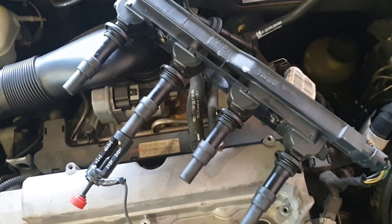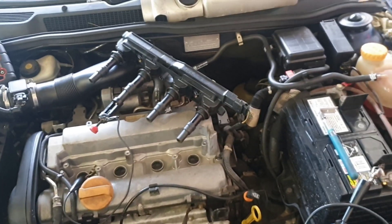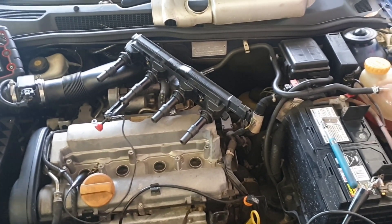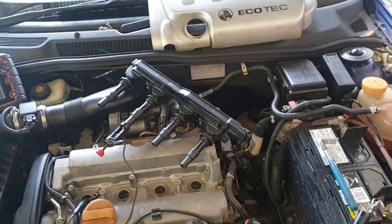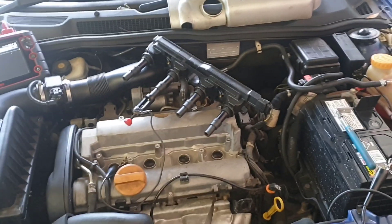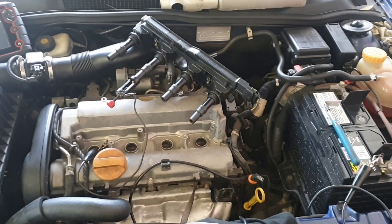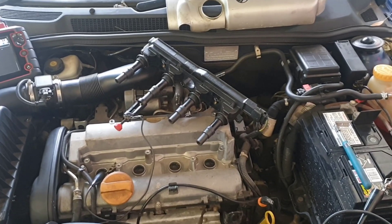So although we have electrically a good coil, we have poor insulation in this area here and it's easily able to jump out. So the thing does need an ignition coil. It's going to get a set of spark plugs as well. And then we'll just check some basic things like fuel trims just to make sure there's not a gross failure — a big lean problem. So positive fuel trims could be making that coil, the spark, have to work harder. But I think it's just going to be a typical ignition coil — in this case an insulation problem as opposed to an electrical problem.